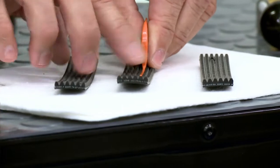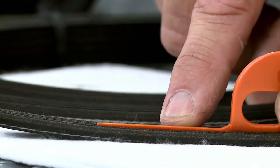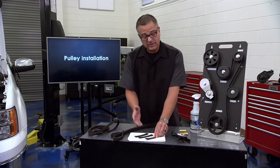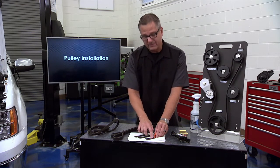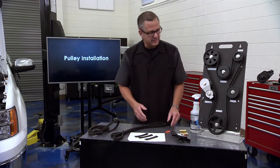The ribs are getting deeper and deeper - we're introducing heat into the pulley. On the aged belt, it sticks out a little bit, but on the new one it sticks out quite a bit at the top. After 100,000 miles you could bend these belts and really wouldn't even see any cracks. So it's important that you use this tool - it's important that you have a belt that rides right, not introducing heat, and tracking correctly.